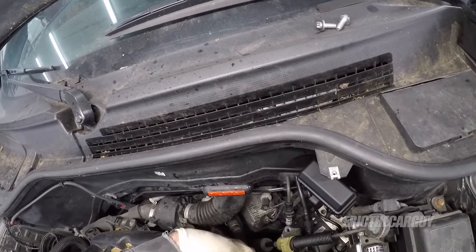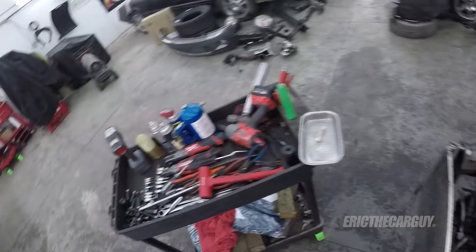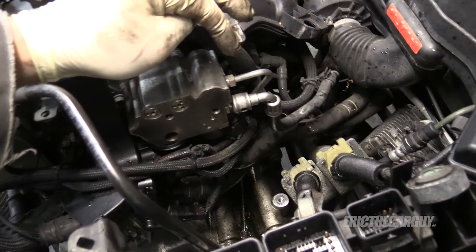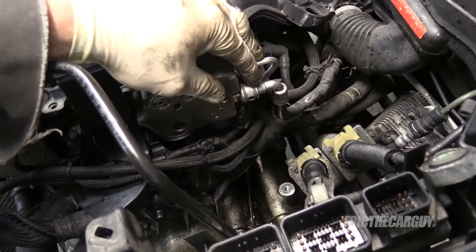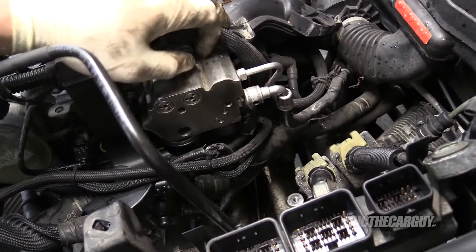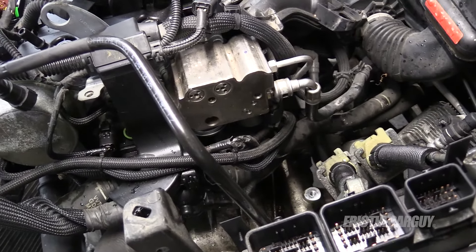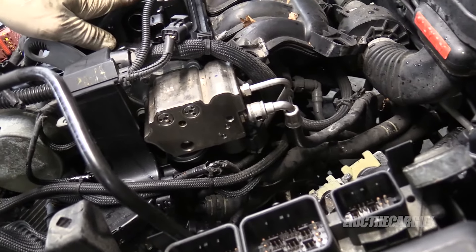Let's see if I can get away without one though. It almost looks like I can get down in here with my pliers and just depress those things and pull that off. This, by the looks of it, is a direct injection engine. So fancy. Okay, so what I was doing to remove the fuel line was correct. There is a special tool for many to do it, but also you can use hose pliers. However, apparently there's a problem with this line sealing, so every time you disconnect it, it needs to be replaced. Therefore, what I'm going to do instead, rather than trying to pull this off of here now, since it wasn't leaking or anything, I'm going to pull the whole fuel pump off. I'm going to disconnect this hard line back here and just remove the fuel pump. It's not timed or anything. It goes onto the camshaft on the inside here. So rather than trying to mess with this fuel line, I'm just going to take the fuel pump off and lay it back over here just like everything else and continue to move forward.